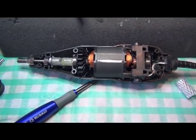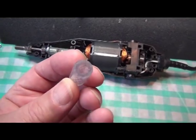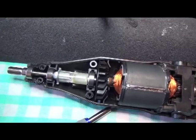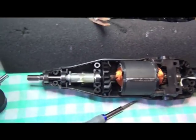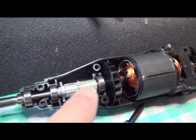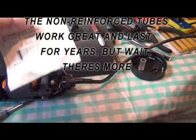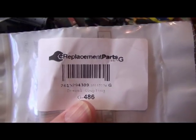I got a bit ahead of myself — I got this back together. But I want to tell you what I ended up doing. The fiber-reinforced hose was too rigid and would not conform around the spline teeth. So I went back to looking for an actual coupler, and believe it or not, I found them. Dremel shows them, but when I went to the Dremel website I still could not find them. I ended up going to replacementparts.com.